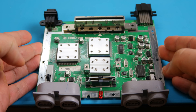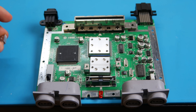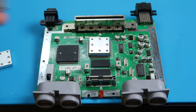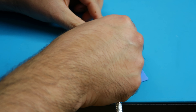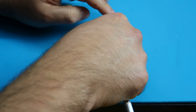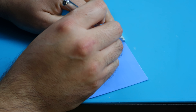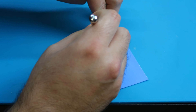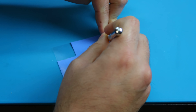Here's the N64 motherboard. I already did a practice run on the new thermal pads. These other two blocks still have the old gray thermal pads on them, so we're going to be replacing these — kind of dirty, so definitely worth replacing. With the half millimeter pad, we're going to take the block and an X-Acto knife and place it carefully at the very top corner and do a trace cut. Make sure you use a little bit of force so we can cut through and take the cutout out.